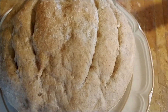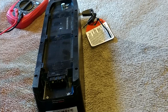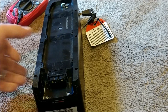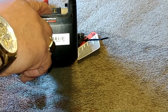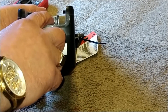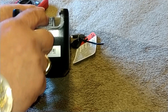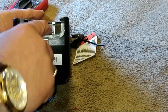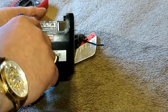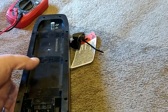Okay guys, I'm going to show you how you check the voltage on your battery — same applies to the electric bike. First thing you want to do is very carefully locate the terminals here. Use a magnifying glass if you have to, but they should be marked plus and minus. In this situation the right side is positive, the left side is negative — the main big holes right here. Also make sure you have the key in and your battery turned on.